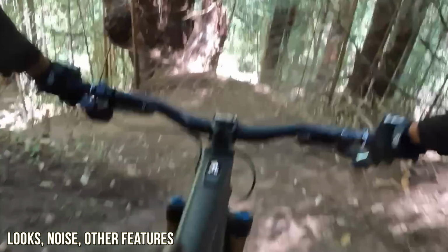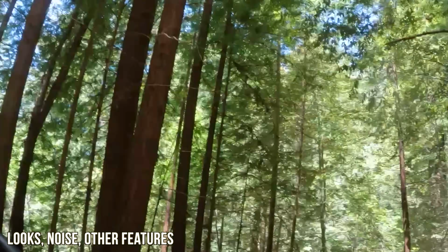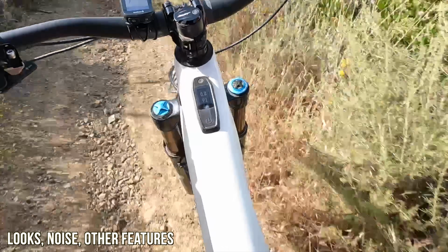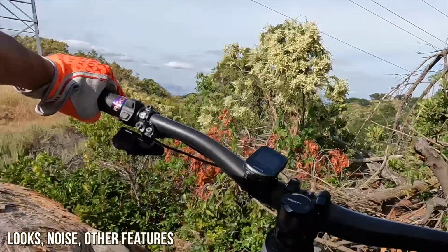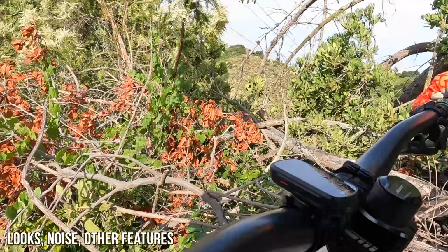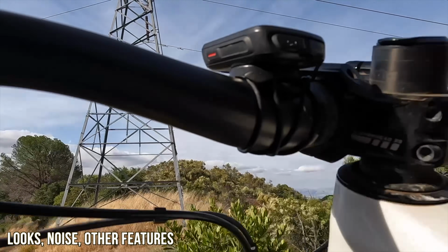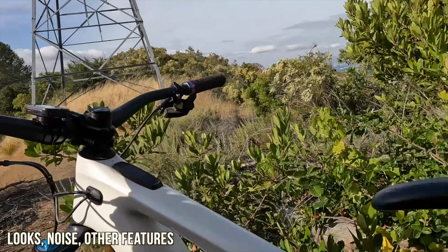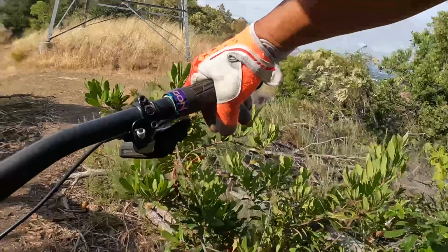In terms of high power, high heat dissipation rotors for e-bikes and enduro bikes, the TRP DHR Evo takes high marks for having a 2.3 millimeter very thick rotor in 220 millimeter size. So very heavy at 270 grams, but in some applications that doesn't matter. What matters is power. Now companies like SRAM and Magura are using 2.0 millimeter rotors, so a little better. And some of these companies like Shimano, they don't have the 220 rotor available in good spec levels, like XT. So there you have it.